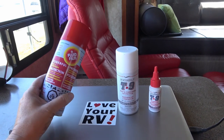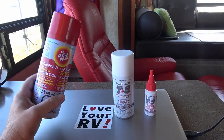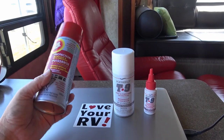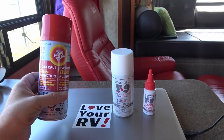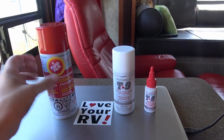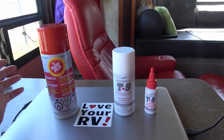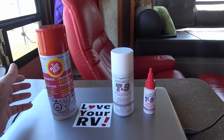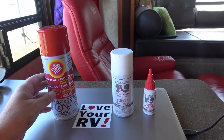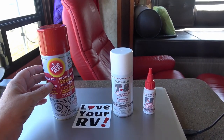The Fluid Film works well - it prevents rust really well. I think I may still use this because you can get it a little bit cheaper, especially if you buy it in more of a bulk quantity - you can get the price down quite a bit. What it does is it gets an oily film that it leaves and then attracts a small layer of dust. Once the dust is attracted to the layer, it's fine - it'll just stay like that. But that's not good in a moving part situation. So I'll use that for maybe the undercarriage and things like that where I don't care if a bit of dust shows up onto the Fluid Film - it'll just prevent any corrosion from taking place.